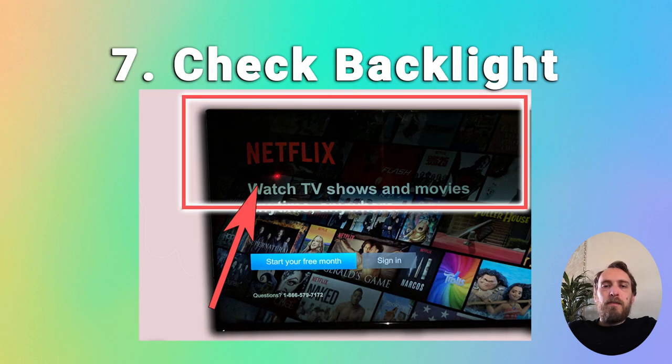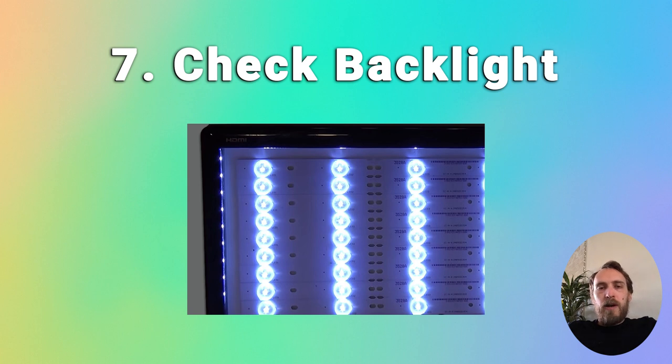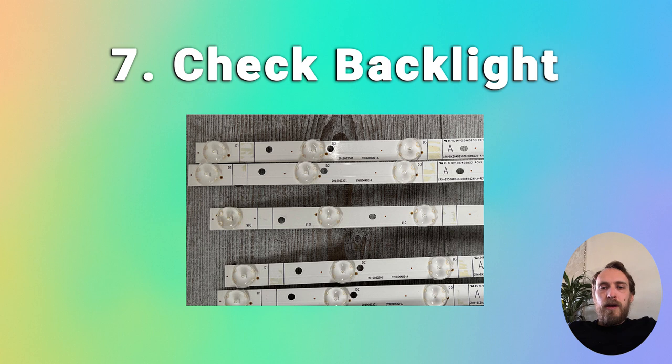If none of that has helped, it's probably a hardware issue, which should still be fixable depending on what exactly the issue is. If you have dark areas on screen — say the top half is darker than the bottom half but you can still see the picture — that is almost certainly a backlight issue. The backlights come in strips, and the joints between them can fail, causing a whole strip to go off, or an individual LED may fail causing a darker area. These are quite deep in the TV and require disassembly, but it is possible to do yourself. It's cheap and easy if you have some technical skill, and there are instructions in the linked article below.